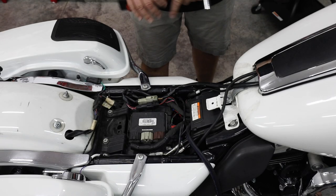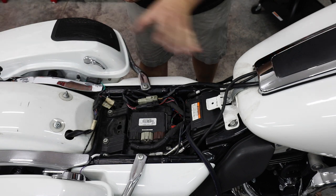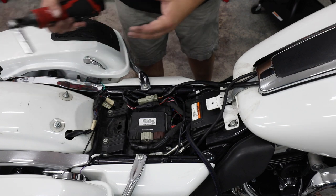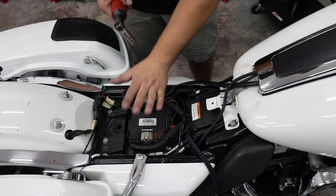I've already removed our seat — a simple Phillips screw got the seat off. That's not going to be like that for long; we'll be putting a Robert Becker-designed seat lock on it soon. Once your seat is off — whether it comes off via a thumb screw, Phillips screw, or a lock — you'll see your battery cover.